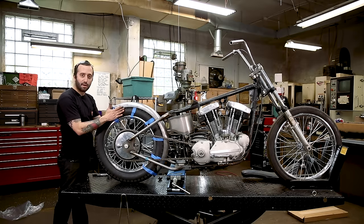And you're gonna wanna do that basically between each step, because we're gonna mount it in the middle, we're gonna mount it in the rear, and then we're gonna also mount it low. So each time you just wanna make sure before you get too far and you've realized that you've mounted a fender really crooked on your bike. So just make sure to keep checking that, because this fender fits really tight on this tire. So you don't have a lot of play if you're gonna try to straighten out and center your tire and your fender later.